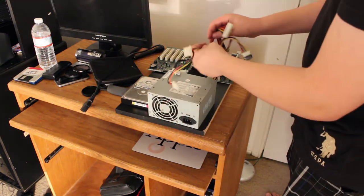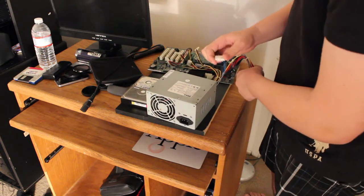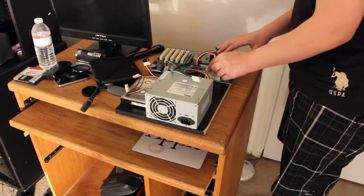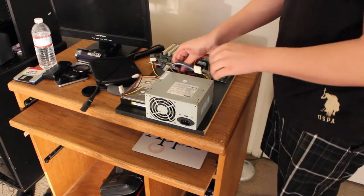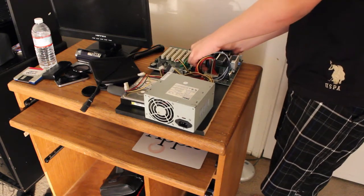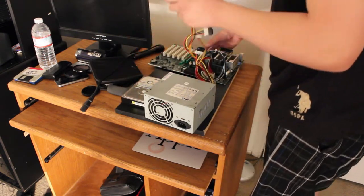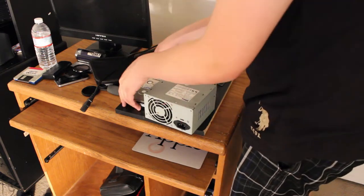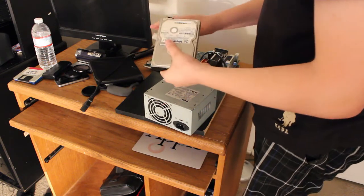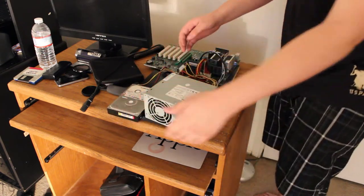Which I think is just — even today — it really shouldn't fly, because this is the excuse for power they were using for the CPU. They don't use the standard 4-pin that we use today, or 8-pin in some configurations. No — they decided to make it so that you could not upgrade the power supply in this thing. But apparently they made a decently solid power supply. At least they didn't go with Bestec. I always say I would not touch Bestec power supplies with a 10 foot pole, because there's probably a good chance that it will send electricity through said 10 foot pole and could probably kill you. Life lesson there, kids.